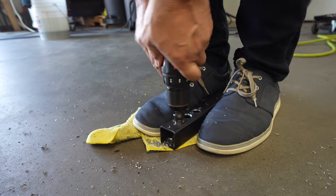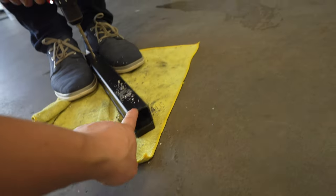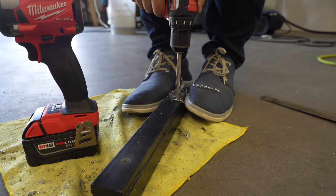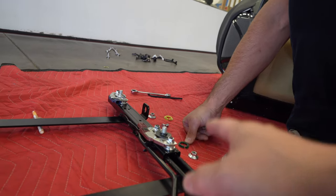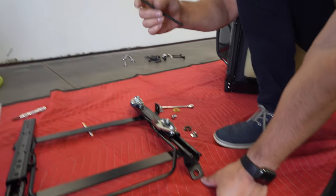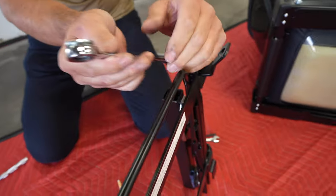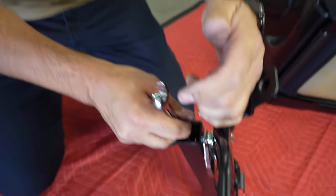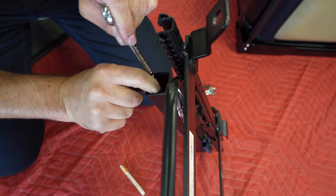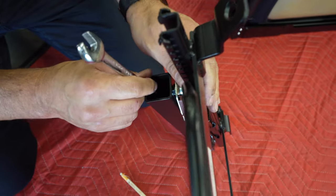We're drilling the holes to mount this bracket to the other bracket. Once anchored down we tighten everything — it takes a 6mm Allen key and a 12mm wrench. This is the factory hardware that comes with the donor seats. The best way to fasten things in such a tight space is to go upside down, put the nut in with the wrench, let it secure into place, tighten by hand all the way, and then torque it down with the wrench.